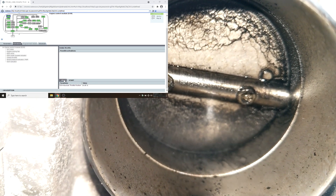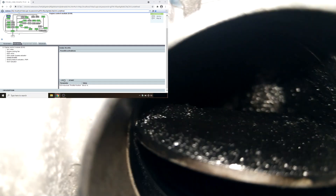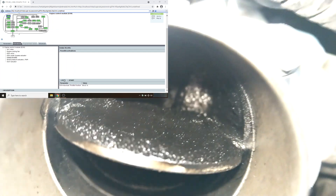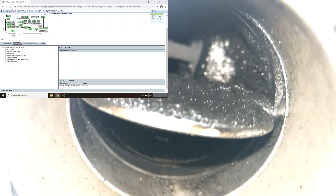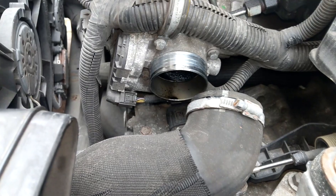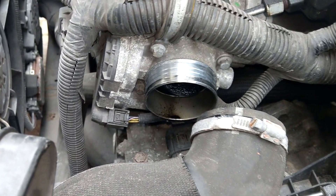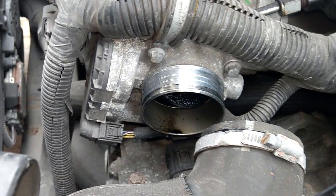And it really was that simple. Of course, cleaning it up with carb cleaner is good preventative maintenance, and that will happen in the future, but there's certainly no issue with this throttle body right now. I was able to eliminate that and move on to the next thing. So yeah, if you suspect your throttle body and you have diagnostics to move it, this is a great way of just doing a visual inspection and making sure everything's working as you expect.